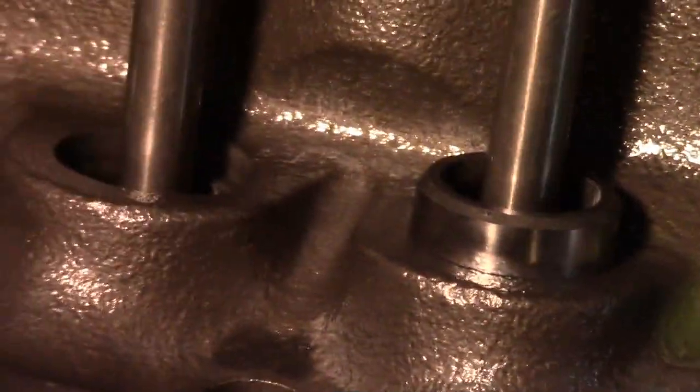You can see there — I'll get a little different angle on it here. You can see that there's still a few droplets hanging on the valley wall there. If the light is not just right, it's really hard to see it. Right back in there again. I'll get the second light out of the way, and then you can see it. And then down in the valley further, you can see coolant laying down in here with the lifters.